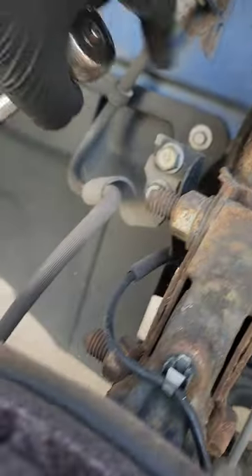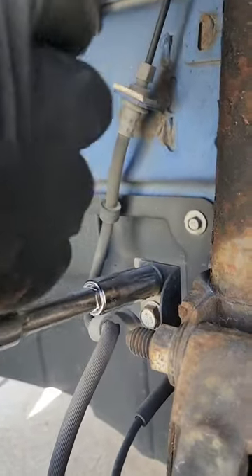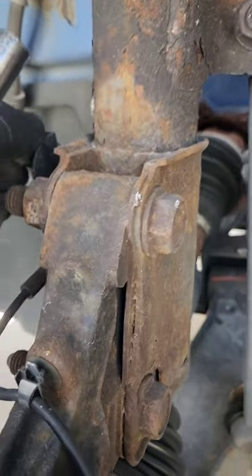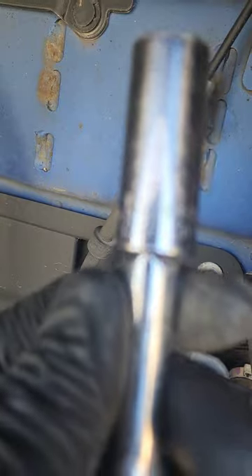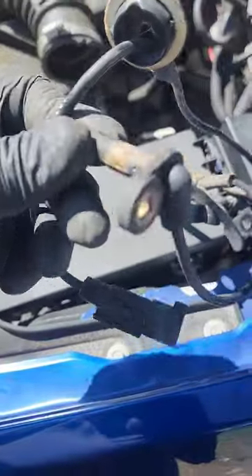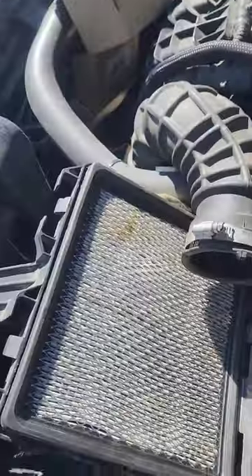So what I'm going to do is take this one off. Once it's at the top, that's a darker bracket — you don't want to take that one off. I'm doing all this one-handed. There it is — came off easily. I'll take this one out as well. So we've got the old one removed, and I can tell you it was not easy. Everything was in place pretty good. In order for me to reach back in there, which is almost impossible, I removed the back part of my airbox, so it allowed me to reach through and grab it.